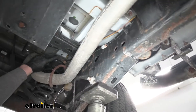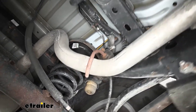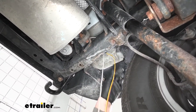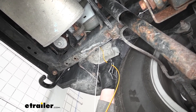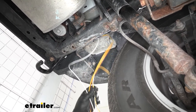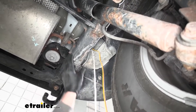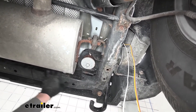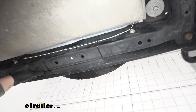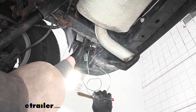The wiring comes up through here and over the rear subframe, then drops down on the driver's side. Here I pulled the green wire off of the yellow and brown. I took that saved white wire, taped the end to the yellow and brown, then took the other end of the white wire and the green wire and routed both over to the passenger side, running them along the back of the bumper beam and up over the frame rail.